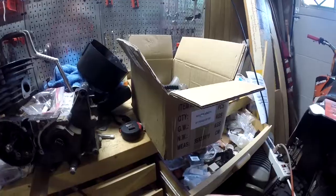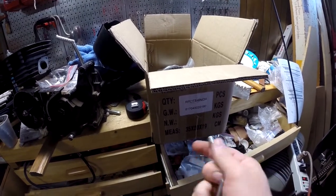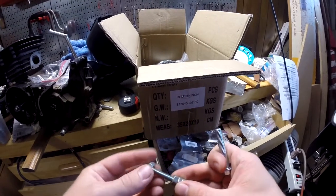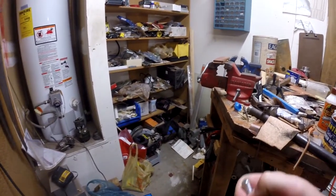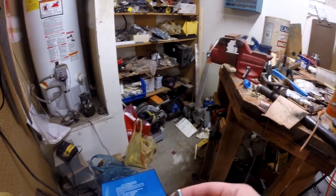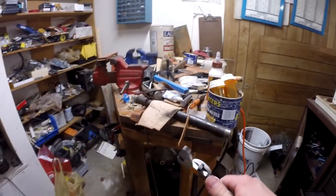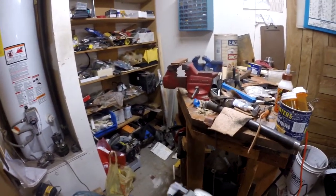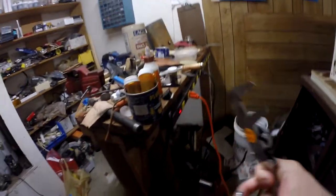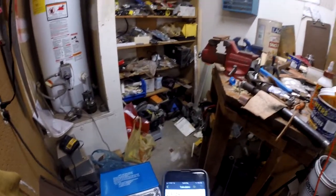It's probably a quarter-20. A lot of things are quarter-20. But this looks a little bit skinnier, so it's not a quarter-20. It's probably more like a 3/8-20 or something like that, but it is 20. I haven't found a tap so far that would fit this. One thing I could do to measure the bolt is use some calipers to get a general idea of the size. So that's about .31 — 5/16ths is about .31. So this is a 5/16ths bolt. I don't think I have any taps of that size, so I'm going to have to go find one.